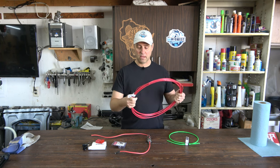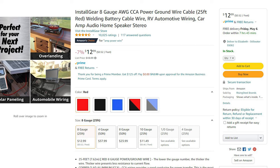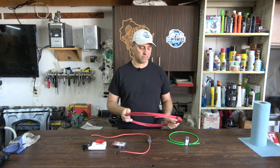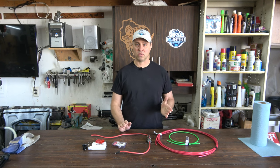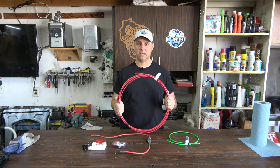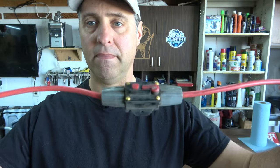All these parts can be bought online — I'll put links below. One important warning: you'll find 6 or 8-gauge wire on Amazon for around $20, but do not buy it — that wire is aluminum. For a long run like this you need copper wire; aluminum just won't cut it. I found good copper wire at Lowe's, which was actually cheaper than the auto parts store. Here's a close-up of the circuit breaker — just unscrew the end caps, insert your wire, and there's a small button to reset it.